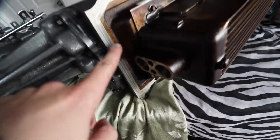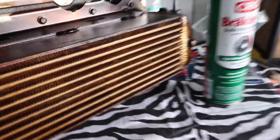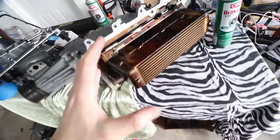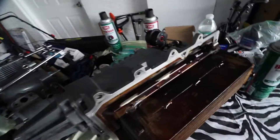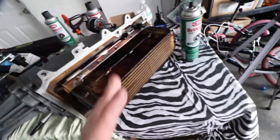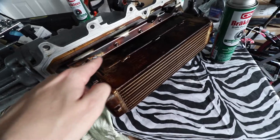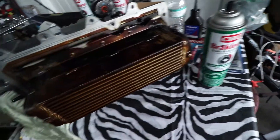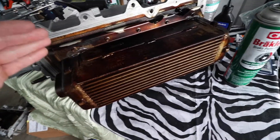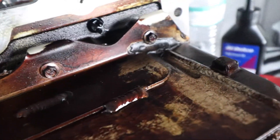You can see how dirty and filled with oil this intercooler is — you can actually see oil on this border, it's just filthy and nasty. We're gonna try to take this off today and clean it up. For the next video we'll do a comparison between a ported and a non-ported one, so stay tuned. These bolts supposedly break when you take them off, so they say to use a torch to heat them up and break the thread-lock on them.